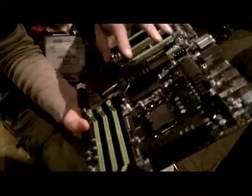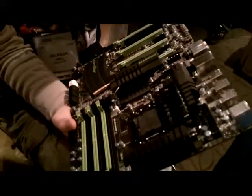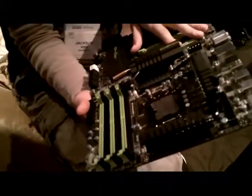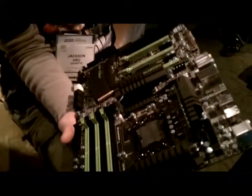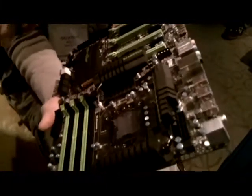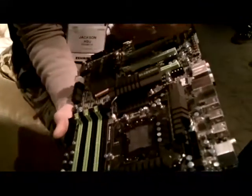Performance is also very important. This is an X58 platform. We have a standard series with our P67 Sandy Bridge board, but for the gaming series we start with X58, because it's still the enthusiast platform for Intel. You get 6-core CPU support, 3-channel DDR, and most importantly 2x16 PCIe Gen 2 graphics interface — so you actually support 2x16 or 4x8. Whereas in the mainstream segment, the P67 or P55, you only get 1x16 or 2x8. If you want a very expensive graphics card at $200 or $300 a piece, you wouldn't want to run it on a 2x8 configuration — that's kind of wasted. That's why we chose X58.